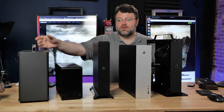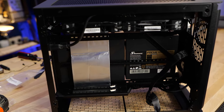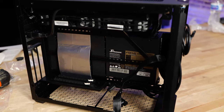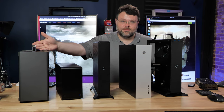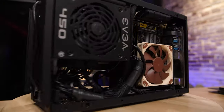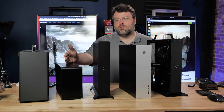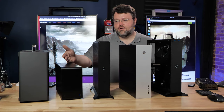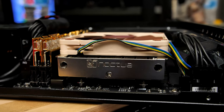The SM560 doesn't have a lot of CPU cooler clearance, but it has the most room for a closed-loop all-in-one cooler and the highest internal volume, so you've got options for custom loop cooling with an external radiator and various power supply mounting options. It's the most flexible because it's the largest. For an almost no-compromises build you could do something with the Dan Case A4, but you'll have trouble on the CPU side — you'd need to give up room for an all-in-one cooler and use a smaller GPU.